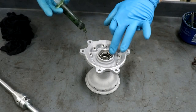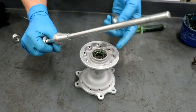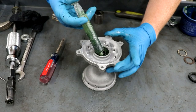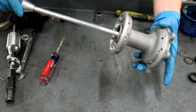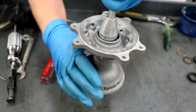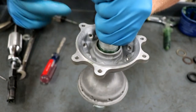I came up with this interesting way of greasing the wheel bearings without having to pull them out. What I've got here is a syringe full of grease and I'm gonna fill up these bearings. I've got this axle for a wheel truing stand that I'm gonna put through the hub, and these spacers make contact with the bearings — that way I can spin the bearings and work the grease into them. You can also use the axle off your bike along with the spacers. I'll put tons of grease on top of the bearing, slide this axle through, and instead of putting the collar with the tapered end down, I'll flip it around and slowly push this collar down while spinning the hub, working the grease into the bearing — basically just forcing this grease down into the bearing.